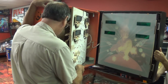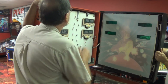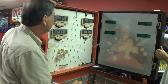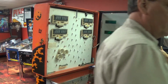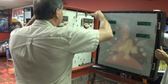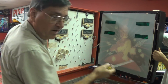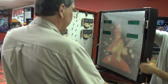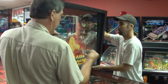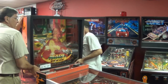All right. Now you know that has a shipping lock as well. There it is. Yes, it does. Okay, so you just take your fancy tool there. I got the box. And this will cross over to the newer stuff too. So look for your little shipping lock. It keeps this from opening up and hitting the glass. It'll either scratch paint, usually it's all it'll do, but you can break it. Here it comes. All right. Ready? Yep. Pull forward, that's the latch.